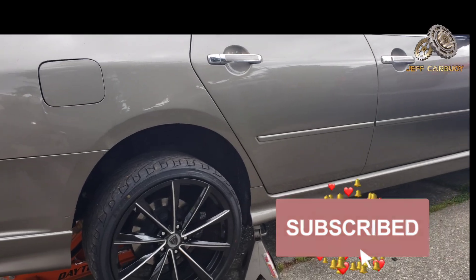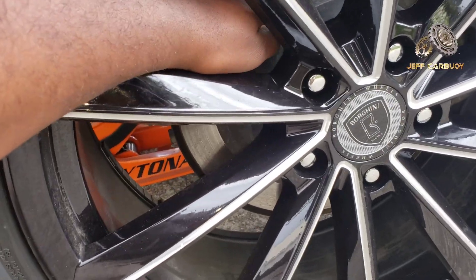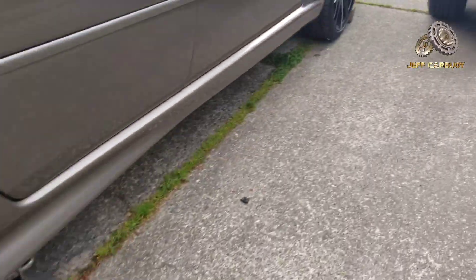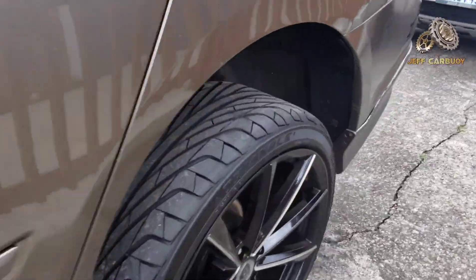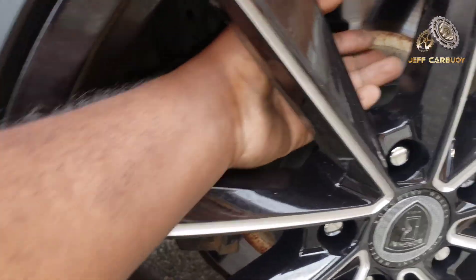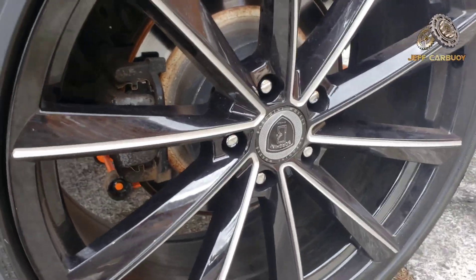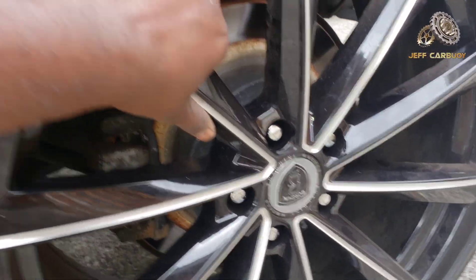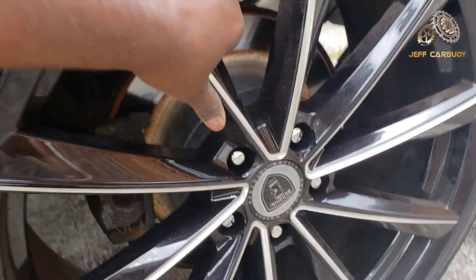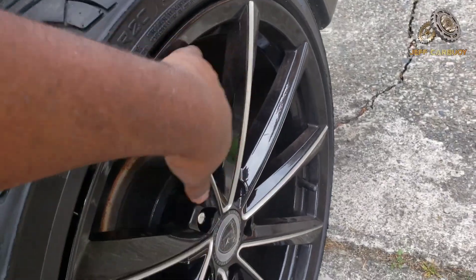The first thing I did was inspect the wheel. I noticed that wheel was too hot, so I checked all the other wheels to compare. This particular rear wheel was super hard compared to the others, which raised an alarm. I thought there was probably some issue with the brakes dragging — either the regular brakes or the parking brake. I attempted to rotate the wheel and it was tough.